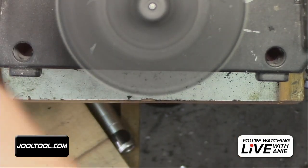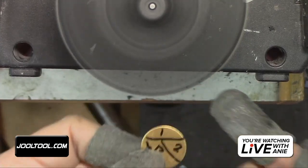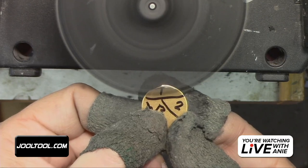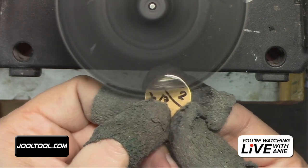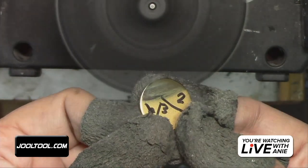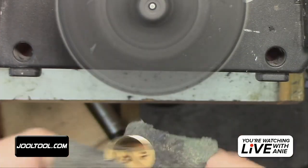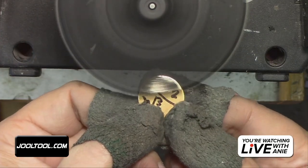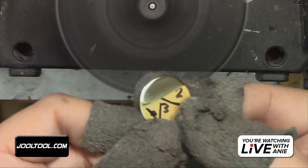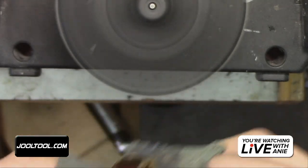So let me go ahead and give myself a good amount of compound. I know you know this, Heidi. I'm going to hold it and pinch it and use my index finger to push up. So look, you just hold it right there. Before I continue pushing, you can see some of the scratch is still there. You guys see that? If that's the case, give yourself some more compound and go in for the kill. Kind of hold it there. Now you guys see what I did? You see how much cleaner that is? There, boom, we got that section.